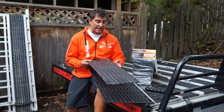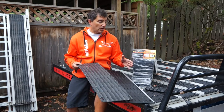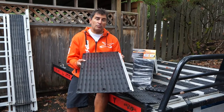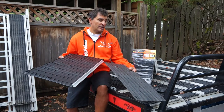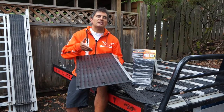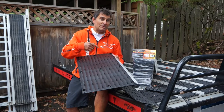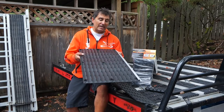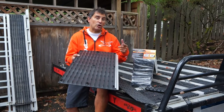The Marlon Explorer Pro Sled Deck comes fully with super glides throughout the whole deck. On the slide outs, one of the upgrades we're going to do is the newest product from Superclamp — the Superglide wide version. The regular version is eight and a half inches wide; this new wide version is thirteen and a half inches wide. Why is this important? It means you don't have to be as precise when loading your sleds in the winter, and if you use your deck full-time in the summer for ATV and UTV, riding up the ramp or parking onto your deck, this provides full coverage for the entire wheel so you get better grip — making it safer when loading and unloading.